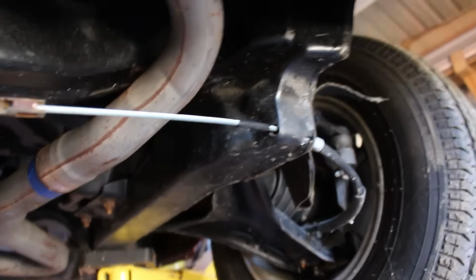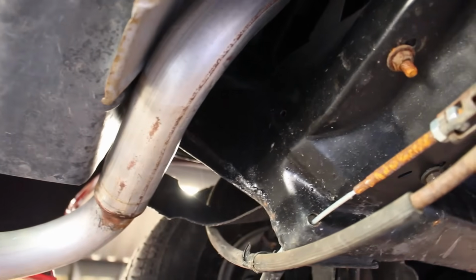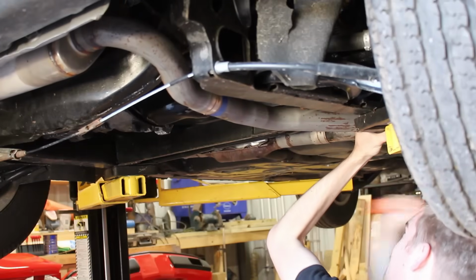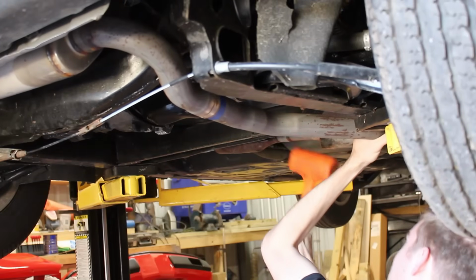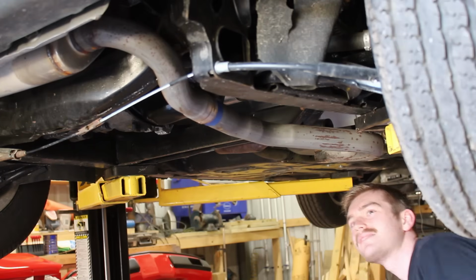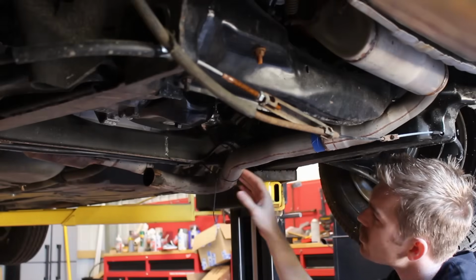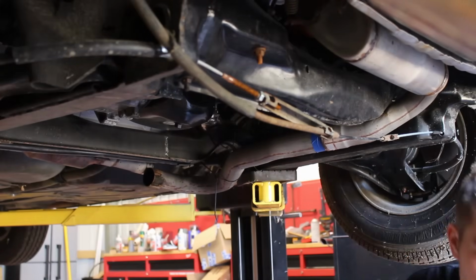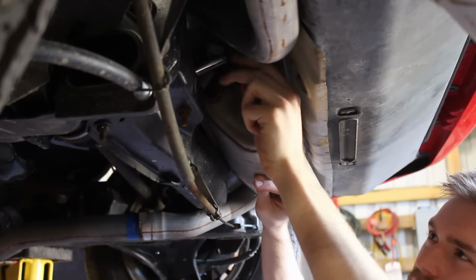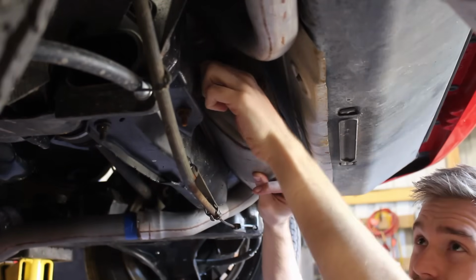I checked. The only bad thing now is that with this pushed back, the outlet tube of the exhaust is now colliding with the heat shield on the trunk. If you remember, I had to modify this exhaust kit a lot in order to get it to even fit remotely, and it's looking like it's going to need a bit more of that here.